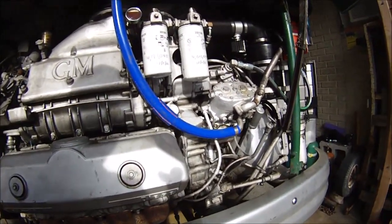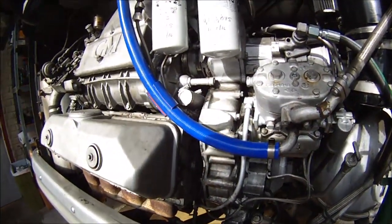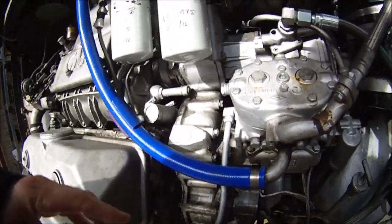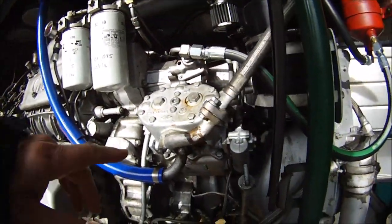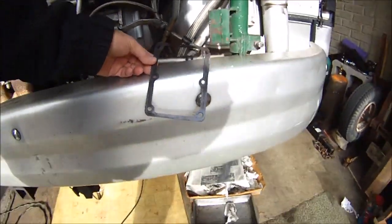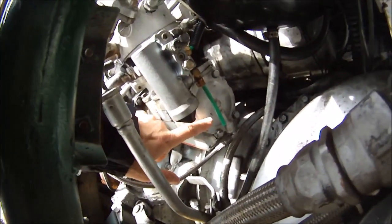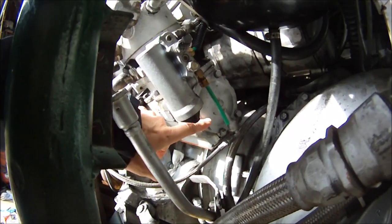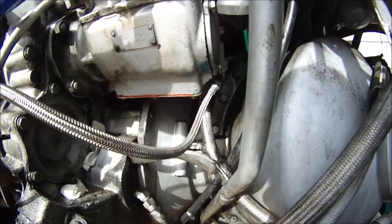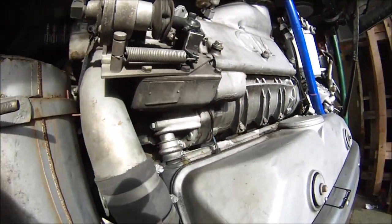The other thing I do is constantly go around tightening bolts on the fittings on the bus. These bolts around the housing for the gear drive and flywheel — every once in a while I snug those up. I snug up the bolts around the oil pan and the oil pan adapter plate. I recently fixed the oil leak on this power steering pump. I had an oil leak on the bottom of the compressor, so I took that off and put a new gasket on. There's also a gasket on some compressors that goes around the end plate — this one has an O-ring that was leaking, so I have the O-ring ordered. You can still see the remnants of the oil from the power steering leak. I go around and tighten things up because they get loose, and if you don't stay after them you have a terrible mess on your hands.